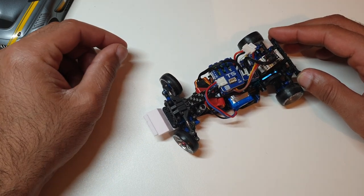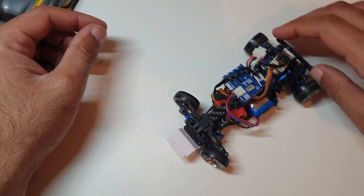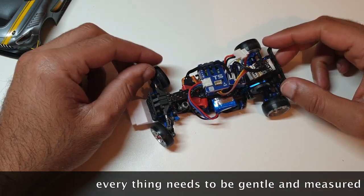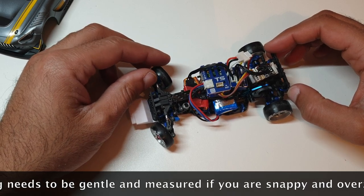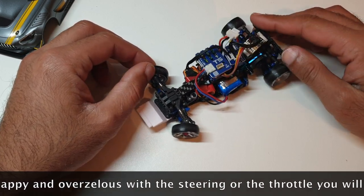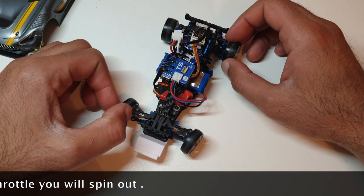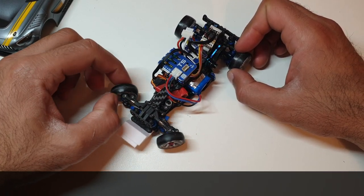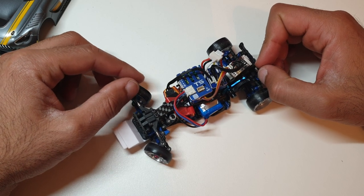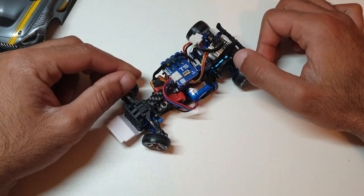Then you might find a sweet spot where your wheels are almost sideways and you're almost doing a side crawl. At that point you can keep your throttle and steering in the same position — normally it's sort of full lock on the steering angle. From there, if you want to change how the car is angled, you almost have to steer out of it, and you'll see in the video it do some twitches where I'm changing the angle. You start to feel the control and position of the car and can adjust how it's sitting just by doing these twitches — twitch into the turn, then back out again, steering in the opposite direction where the gyro would take you. With that you can control the back end of the car, and you'll see it change angle and then stop.